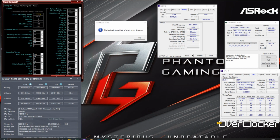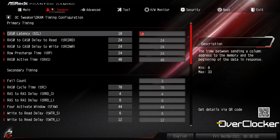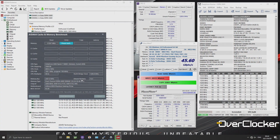So overall, you can see the benchmark results for yourself at the end of this video. There's no reason for me to go through them with you. You can definitely tell that the OC results are significantly better than what you get at stock. Having said that, I don't do much optimization of the subtimings anymore because it just takes too long. So I'll do the basic stuff like TCKE, TRP, TCWL and things like that, if only the motherboard doesn't tune these itself. But for the most part, I'm really not going to bother with that. I'm just going to go for maximum frequency and the tightest primary timings. And that's going to give you the sort of performance that you are actually able to get here.